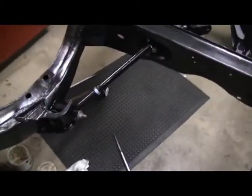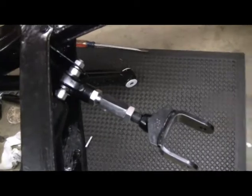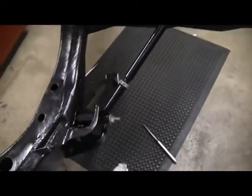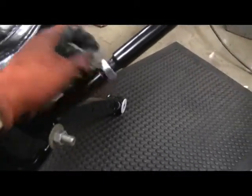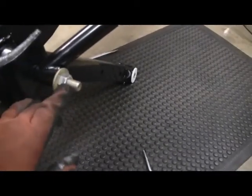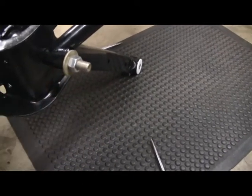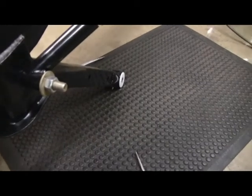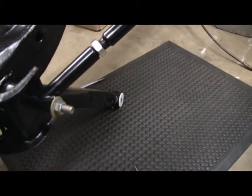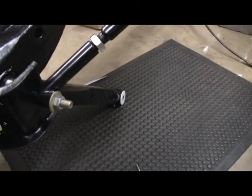Let me show you a closer look at what's going on. Here's the lower control arm, the upper control arm is in, and this is the brace that goes from the cross member down to the lower control arm. These jam nuts are loose — once everything's in place I will tighten those up. I've used these non-lock, non-crimp nuts and tightened stuff down but not all the way. You really should tighten up the suspension when you're at ride height, which I can't do until I get all the weight on it, so I'm going to leave everything just snug and tighten it up after the car's all back together.